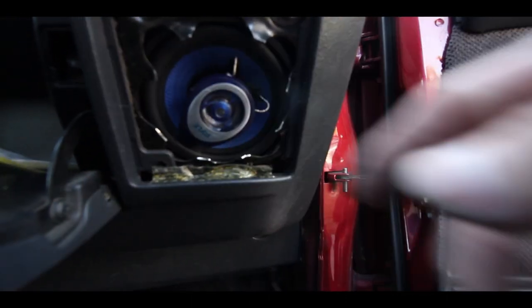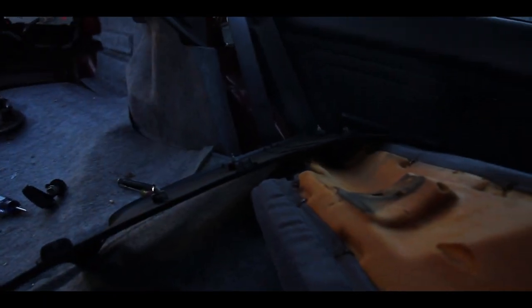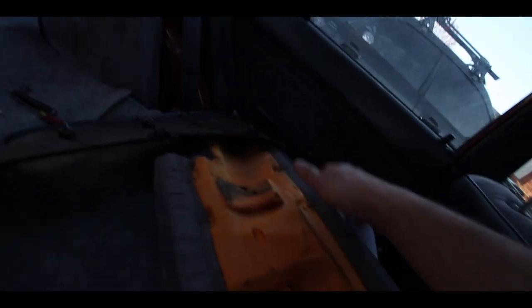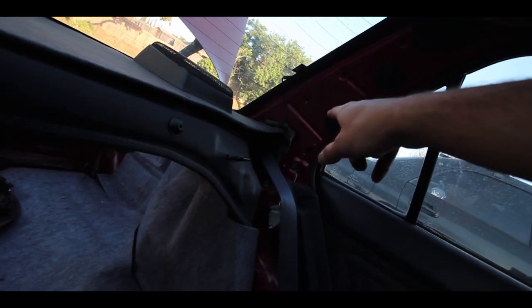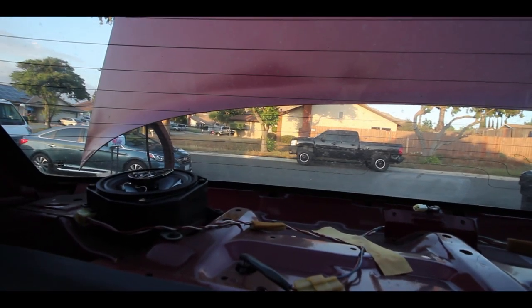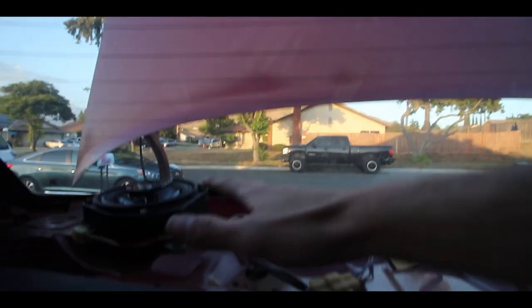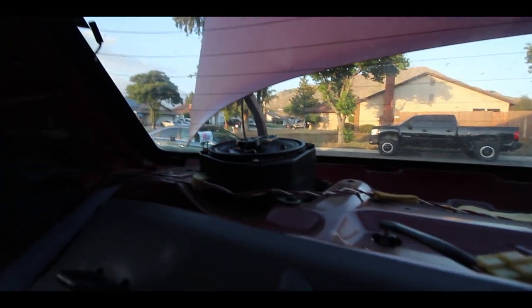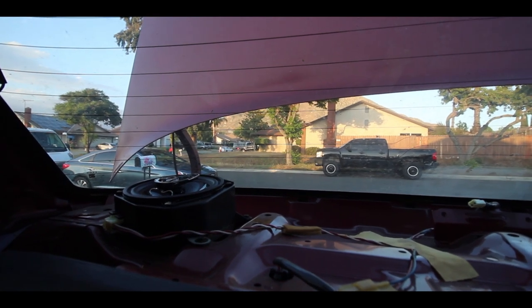I had to cut that, so I'm going to go ahead and pop these out — there's like one, two, and three — so I can try to pry this bad boy up. I'm in the car right now and it's literally a lot harder than I thought. What I did was put the seat down; you've got to pull this other side of the seat off and unbolt the back seat belt right there so you can pop this top panel off. After we get the other side this should pop straight up and then we can change the speakers. There are the new speakers in there. It took me way longer than I expected — I pretty much messed up that little carpet thing up here trying to yank it out, because I swear they probably built this whole car then put everything in through the window on top, because that thing was a pain to get out.